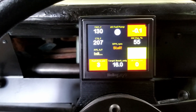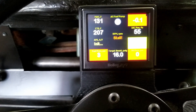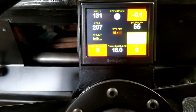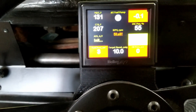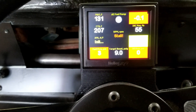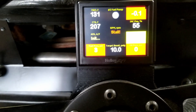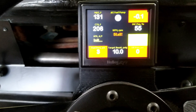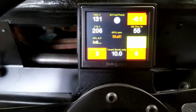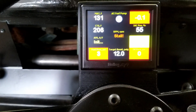This is dome pressure being added to my gate. Scramble adds three pounds, so I'll turn this down to about ten. Now I'll hit my trans brake — you can see it time up. I've got it set to try for seven pounds of boost on the trans brake, and it's adding five more, so that's why it reads 12 when I hit the trans brake.